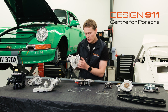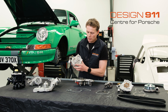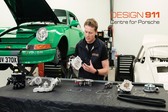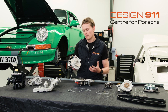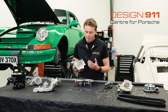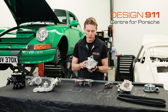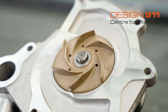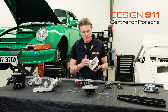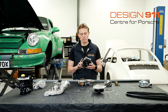If the spindle is no longer supported, the impeller can start vibrating in its recess. If that movement is excessive, the impeller can start catching the edge of the water pump housing, causing it to degrade and break up. If you lose your impeller, you no longer have a flow of water and your engine will overheat. In some cases, even without bearing failure, plastic impellers used in some 911s have been known to start degrading and falling apart on their own.